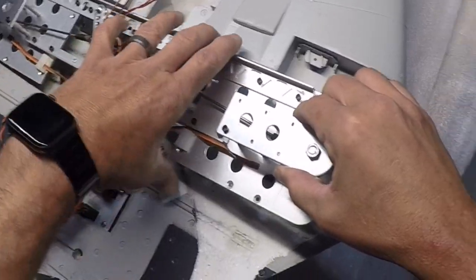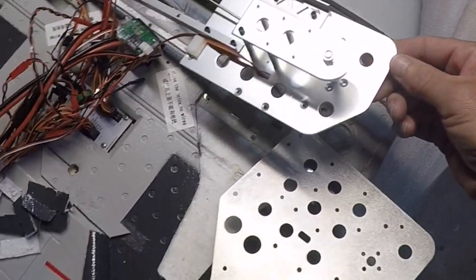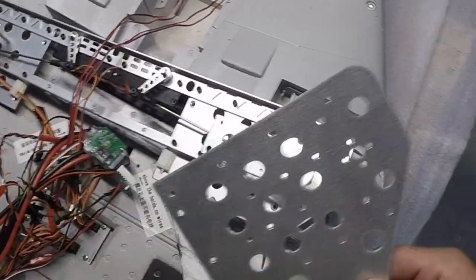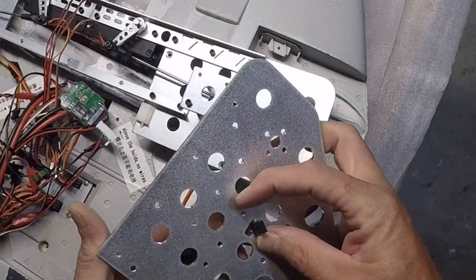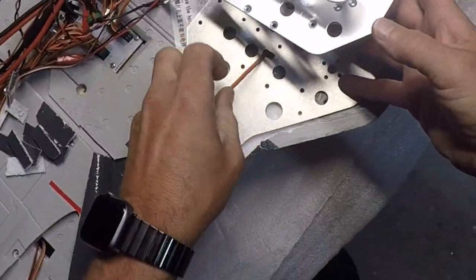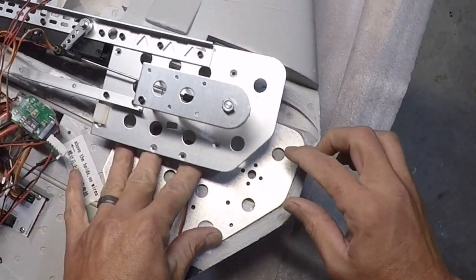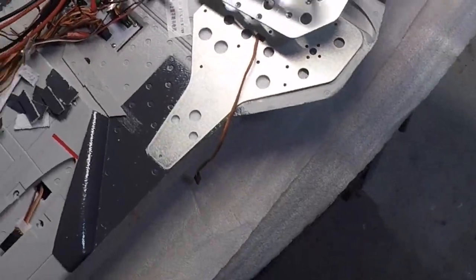As you can see, if I come in here now and lift this whole plate, everything comes out. We'll take this plate off and all of these other components, and this servo wire — the gear wire to our gear servo — will come out as well and go through this hole right here, feeding right back through. No problems getting it through, and then this plate will sit right down where the factory plate was. See how nice and flush that is — these pieces will bolt right back to this plate.